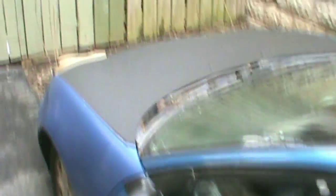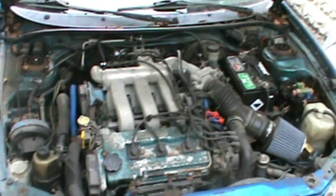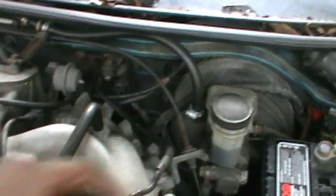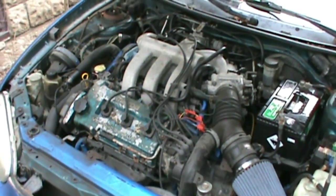Now we're looking at my old car — just gonna put the throttle cable on there for my buddy. Pop the hood — it's seen better days for sure, paint's all wrecked and dirty. I'll show you a picture of what the engine bay used to look like. The throttle cable just goes right there, loops around and comes back up in there. I reached under the dash and unhooked it from the pedal, then pop it out and undo those bolts. Got that switched up — I'll fire it up and rev it for you guys once it warms up.